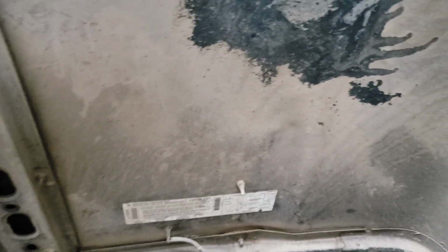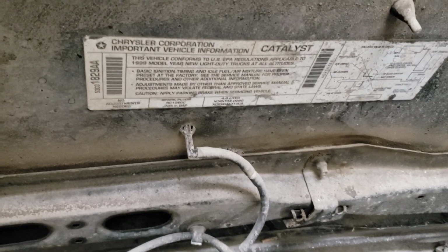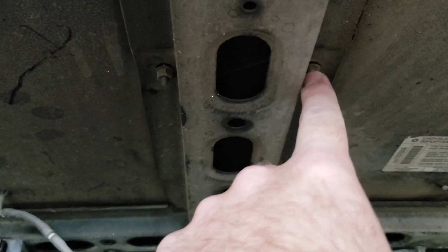So obviously you can see I cleaned the area that the louver is going to go on, but what you'll need to do, so basically we're cutting out chunks on both sides of this support bar. So to start though, you're going to need to remove, essentially it's that rubber brace, so that piece right there, on both sides there, you're going to need to remove the washer fluid little sprayers there, and then that connection bar, sorry it's hard to do with two hands, right there, from right here. I'll get you some measurements in just a sec. Alright, so to remove these components, these are 3/8 on both sides. Just unscrew them and pull it off from the other side.